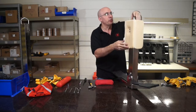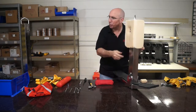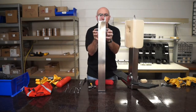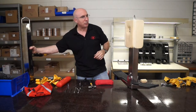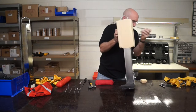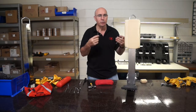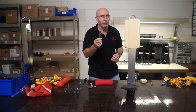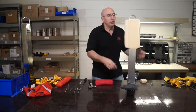Take the foam off, take the top piece off. You might think you'll just pull this — you can't just pull it right off. Well, you can, but you're going to tear up your foam. Because you've got these spacers in here. You can muscle it around there but you're probably going to tear your foam off. So we've got to get the spacers out — this isn't hard. You press on them and they come out. In all likelihood they'll be fine, but if they're water contaminated, dirty, or in any way deteriorated, you'll want to replace them. They're very inexpensive, so we'll just replace them anyway — they're just steel tube. And then the cover will come off pretty easy.